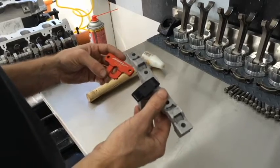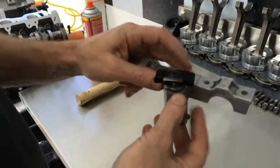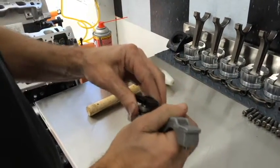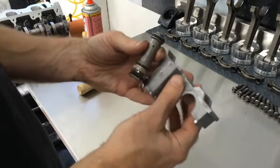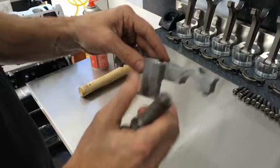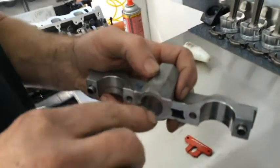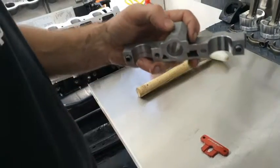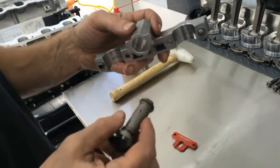To start out, it goes on the driver's side main cap. Simply remove the secondary tensioner by just pushing up on it. It comes up out of the tensioner — go ahead and pull that out. Now, the best thing to do prior to reinstalling into the main cap is to take a deburring knife and go around the outside edge. That allows the new o-ring to slide back in when you flip it upside down, because the tensioner wasn't intended to originally go that direction.